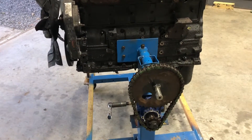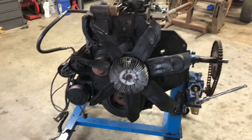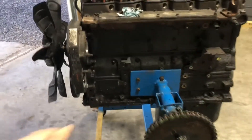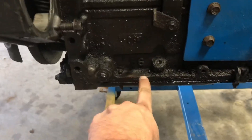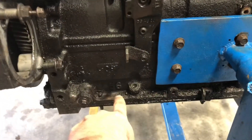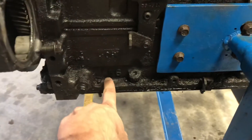I haven't spun the engine yet — it still has oil in it — but I don't see any problems with it. I really appreciate him building it. Here's the engine; it's a pretty greasy old engine but it's a 56 block. For anyone that doesn't know, if you get under the truck, your injection pump is up front, and right underneath the power steering and vacuum pump at the front of the block, right above the bottom ridge, you'll find your block number. Some blocks just have small numbers without a larger cast number.